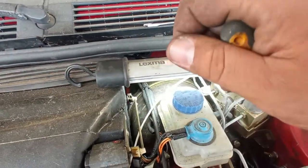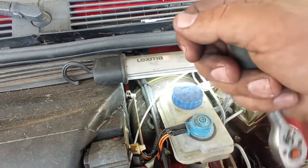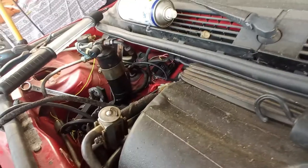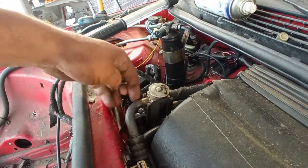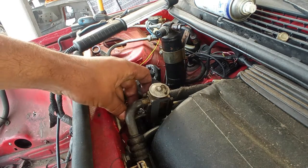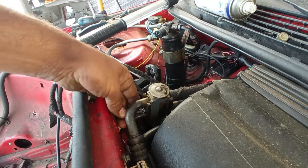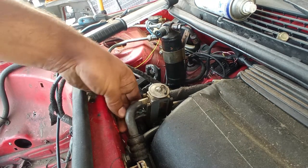What happens is, the cable strips on the selector side, the outside of the cable strips, and as you are choosing the position, it does nothing. It just pushes the cable around, okay? And then I took out the center console, I repaired that issue with the selector, and the car now has heat and cold, because it also has air conditioning,